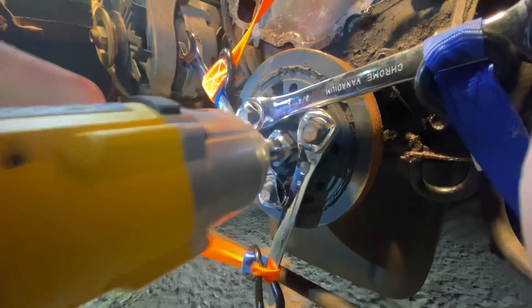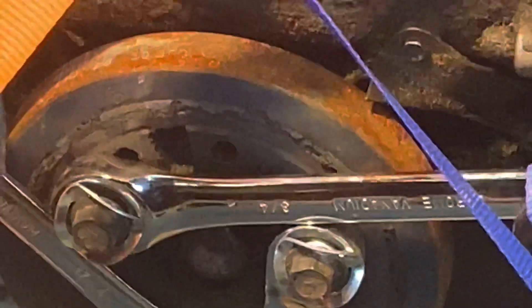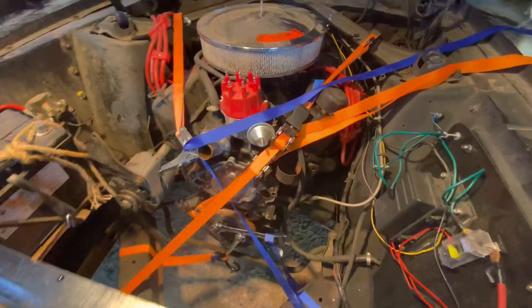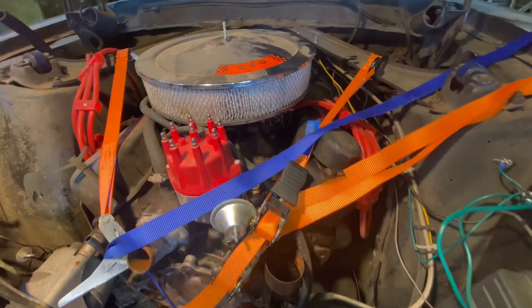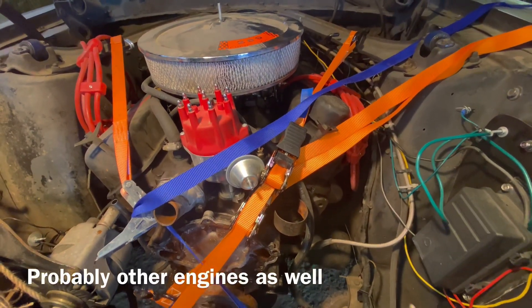You can see my first attempt — I tried to take off that center bolt with the impact gun. Follow along and we'll get through this together. Harmonic balancer removal with that center bolt is a nightmare, so I've devised this solution to help everybody out, here on my 289. This should work on your Ford Small Block whether it be a 302 or 351.